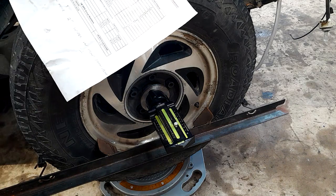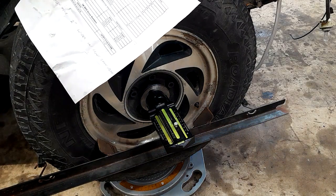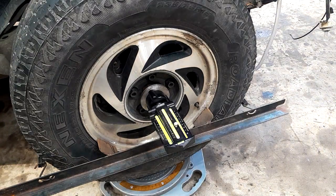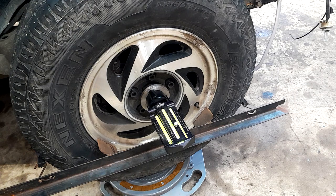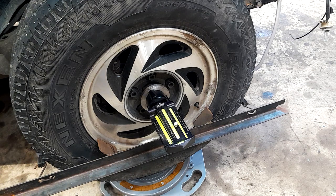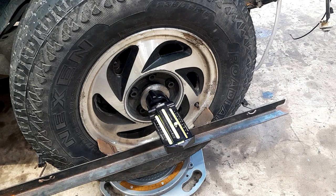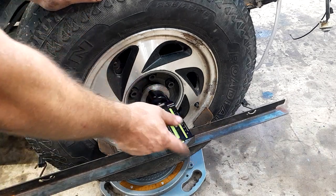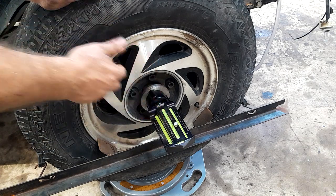The service allowable is two to four degrees. Honestly in my eyes, the more caster you can get the better. That's kind of how I set these up with this cheap circle track racer's caster/camber gauge setup.